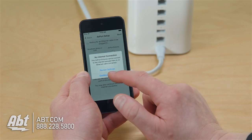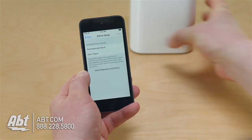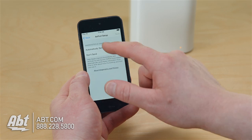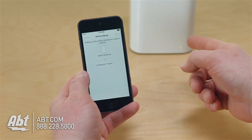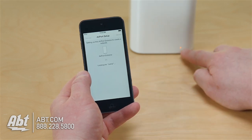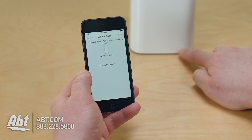I'm going to hit next and continue anyway since I'm not using those settings for this demo. For diagnostics and usage, this is a method of helping Apple — choose whatever you want. Now it's going to change the signal to 'home' instead of the generic Airport name and rebroadcast the home network. Our goal is a solid green. I see it switched to solid amber, which means that during the programming it has now rebooted, and now it's blinking amber, meaning it's done rebooting. Usually it jumps to green next unless there are problems.